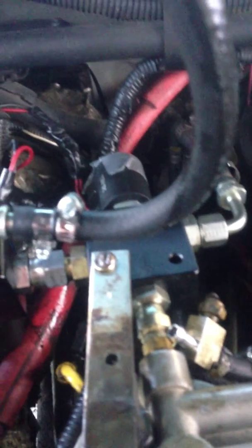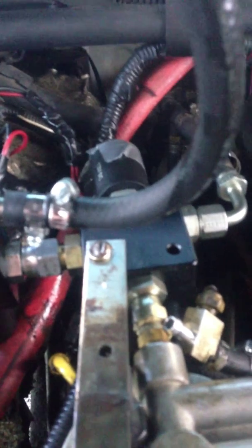From there it goes into the electric heater and then into a supply valve. I also have what I call a diesel redirect valve. Because it's a cam-driven mechanical lift pump on the diesel side, I had to give the diesel somewhere to go when I'm running on veg so that I don't blow seals. Basically, that just redirects the diesel right back into the supply line when I'm running on veg.